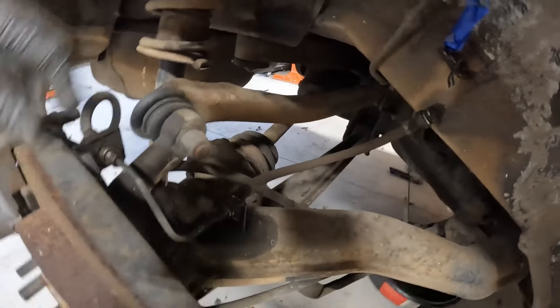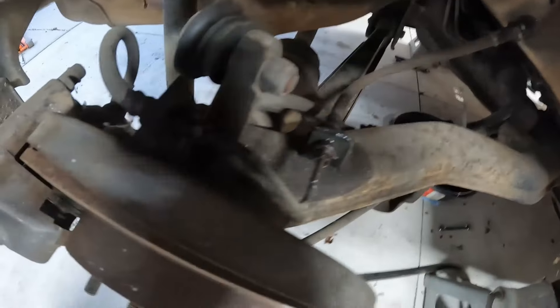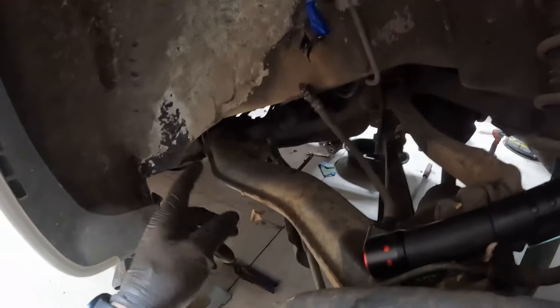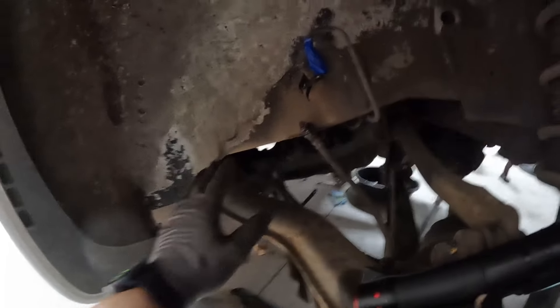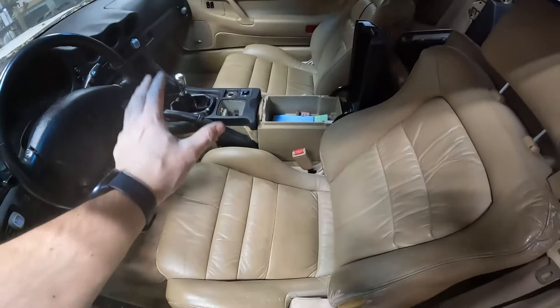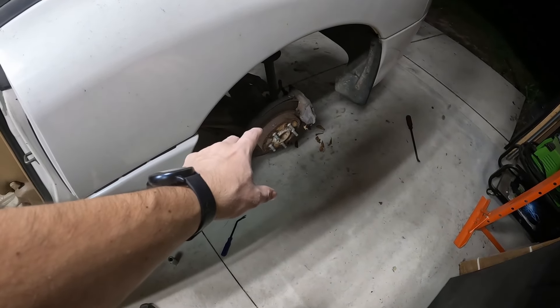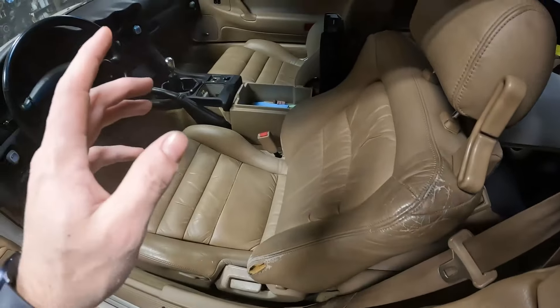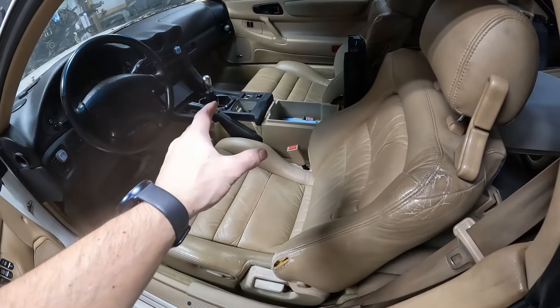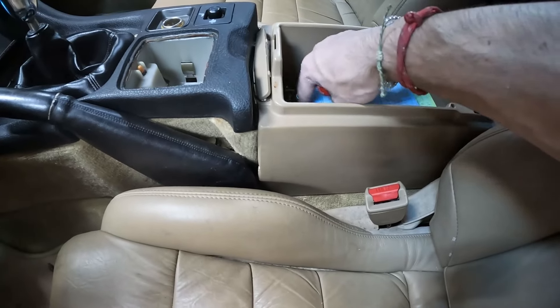What we need to do now is disconnect this sensor piece right here. There's a harness clip underneath the car — follow that line up and you can disconnect it. I believe the last thing we have is to remove the e-brake cables from the car, otherwise they'll still be attached to the rear brake hubs. I'm going to do this from the inside of the car — that's the only way I can think of doing it so we don't have to get into the actual calipers.